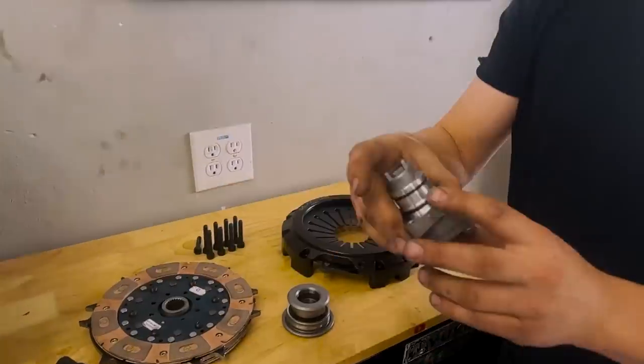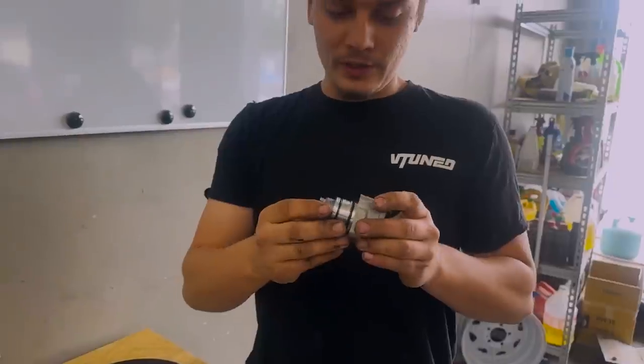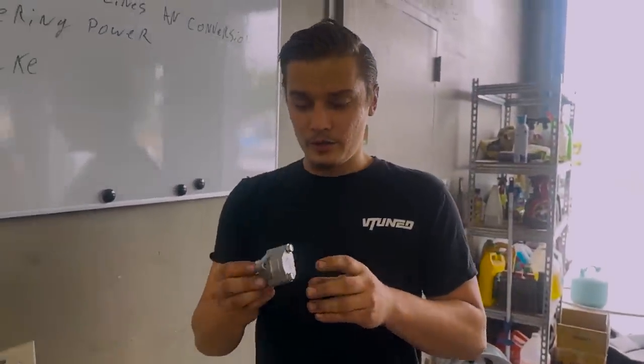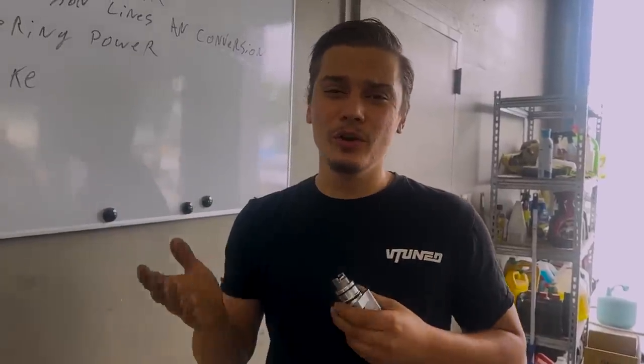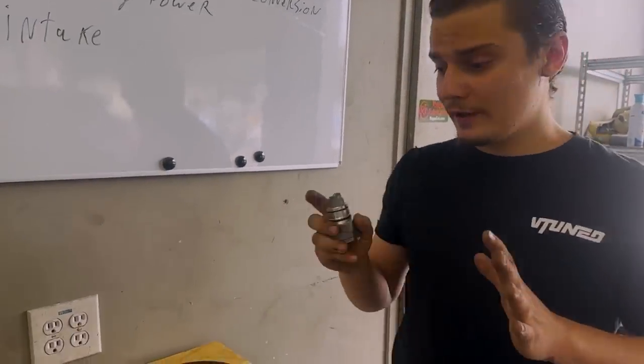And then we also did go ahead and get brand new timing chain tensioners. These go bad under boost applications and whatnot, and we just wanted to replace it because they are really known to go bad on the S2000, even at 40,000 miles, especially if you throw boost at it. So we're gonna replace this too, that way it has a brand new one.